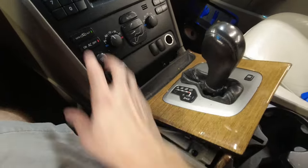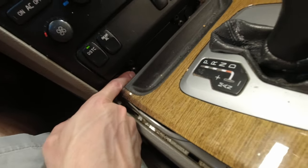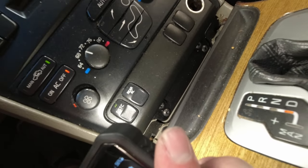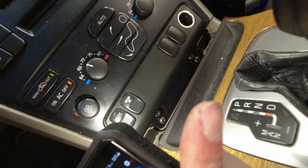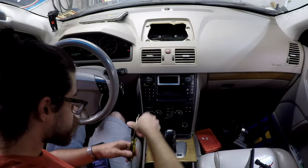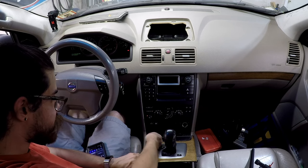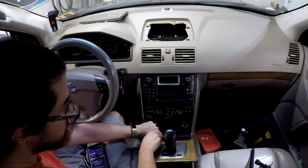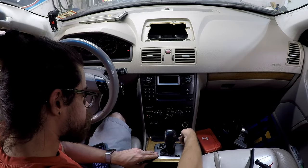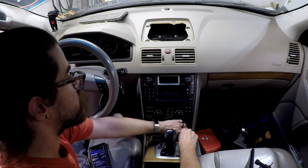So next, to remove this module or pull it out at least, we're going for the 2 bottom screws. There's 4 screws, as you can see in here, and we're removing the bottom 2. The top 2 stay on, the bottom 2 are getting removed. Screwdriver, this is also T25. In fact, they're the same screws as the ones used to hold in the top panel.